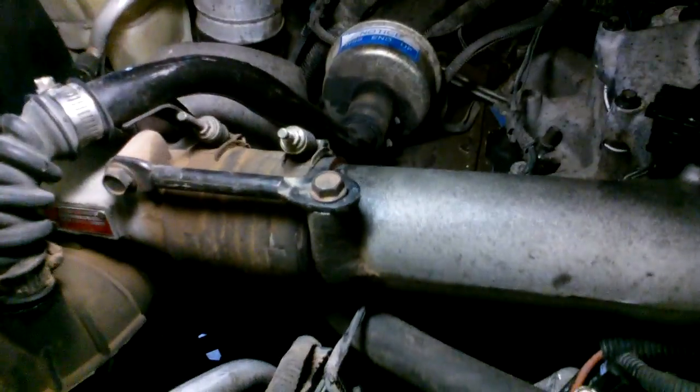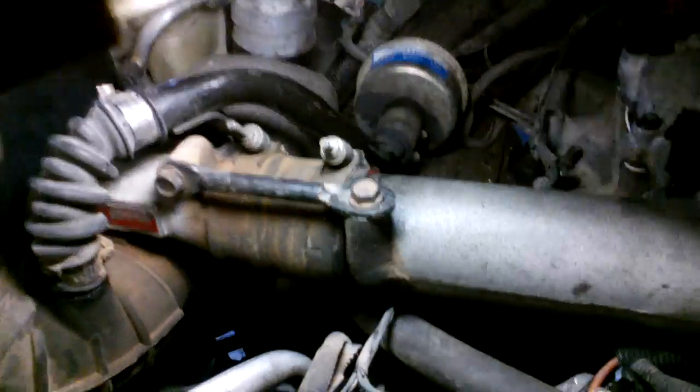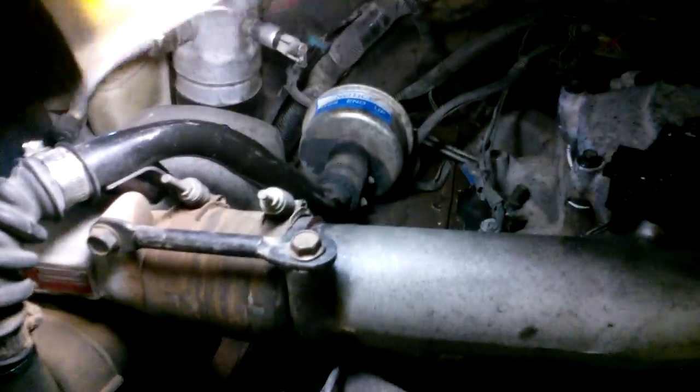I thought it was cutting down a little bit going down the road, and when I got home I popped the hood, and right here in this intake it was just covered in oil. And remember, this turbo here came off that other motor, had all the blow-by, so it had oil sitting inside the turbine here. And what happened is I did not tighten this clamp down. I was so tired I just completely missed it. And it was literally just throwing out my boost beside the intake here, just throwing it out around that boot. And it pushed all the oil across, so that's how I noticed it was not tight.